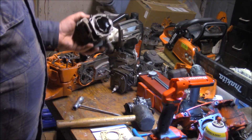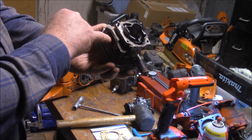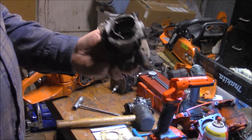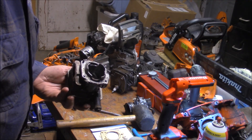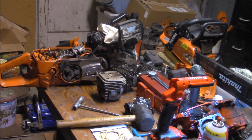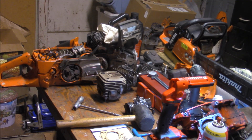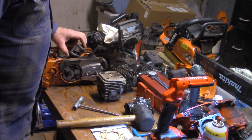And then if I've got a guy who's wanting to make them really scream, I'll go in there and work the exhaust to bring the roof back up. This one here looks like I did mess around with the transfers. Anyway — X-Torq mods, thin gasket, pop-up pistons. That's just simple stuff that anybody can do. I think I'm going to tear that thing down. The cylinder looks like it's salvageable — put a different crank in there, throw it back together, and see if it runs another six months. Maybe get rid of this piston and put a pop-up in there with a base gasket.